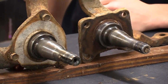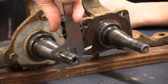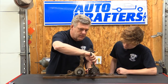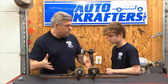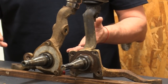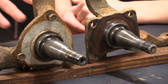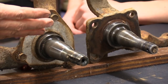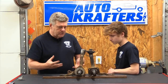Do the same thing on the front bearing — this one's a little shorter. Both bearing sets are different in size, and I think that had a lot to do with the fact that they were running stickier tires and bigger wheels. The biggest thing you could get on a 68 Mustang was a 14-inch wheel with a 70-series tire. In 69, the Boss 302 went to a 15-inch wheel with a 60-series tire — much bigger, fatter profile. I think they started breaking stuff, so Ford decided to go with the bigger spindle, especially on the disc brake packages in 1970.